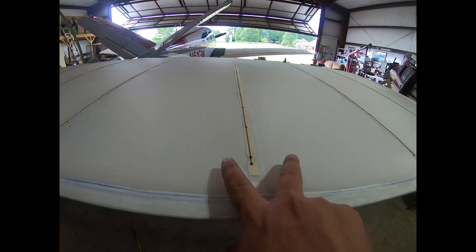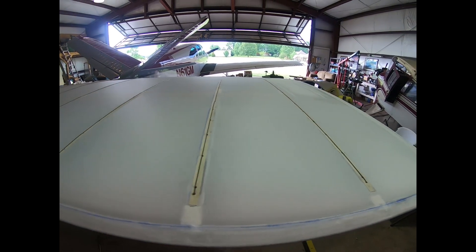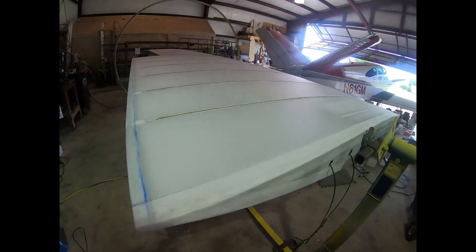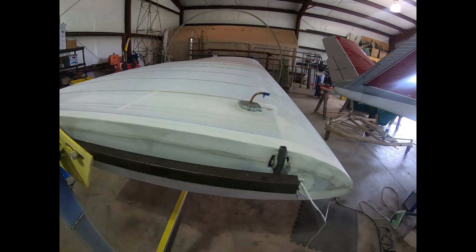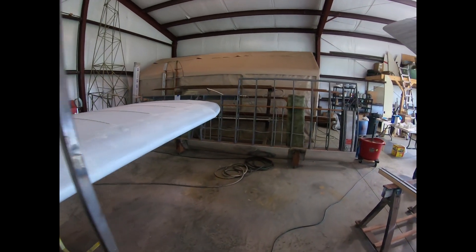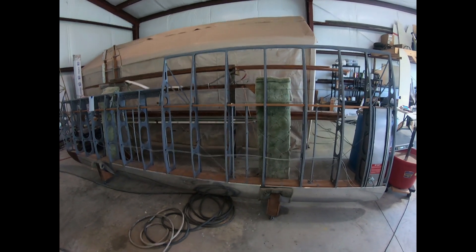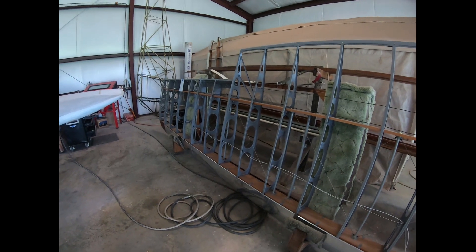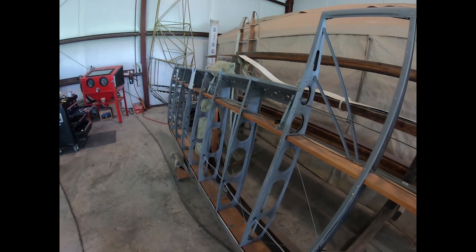The next thing I need to do is draw lines on each rib for a two-inch finishing tape, kind of like we did on the ailerons. That tape will go right down each rib, cover up the wire and the reinforcing tape, make a nice smooth surface — it's more aerodynamic and seals it from the elements. Once those tapes are on, it's time for primer and paint on this wing. I'll probably put this wing in the rack and start on the other wing. If I were working full time, maybe a week's worth of work to do the fabric on one wing. I've got to go back to my normal work schedule for July, but hopefully I can get this wing finished and start painting in July or August.